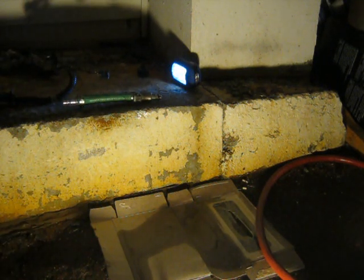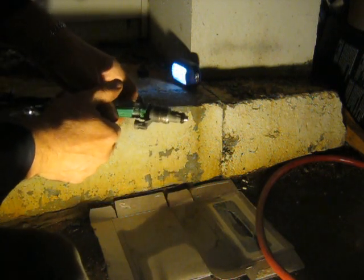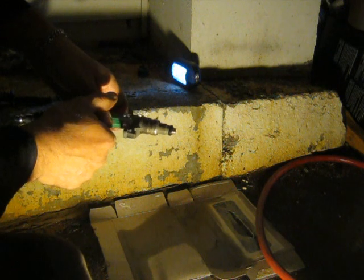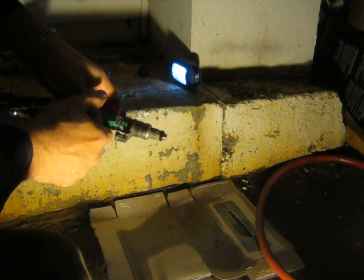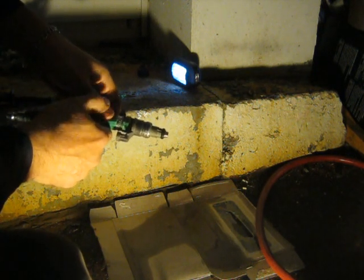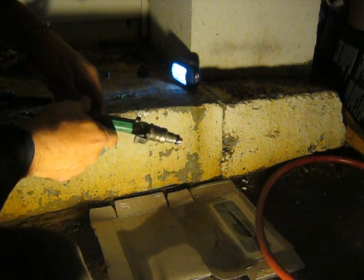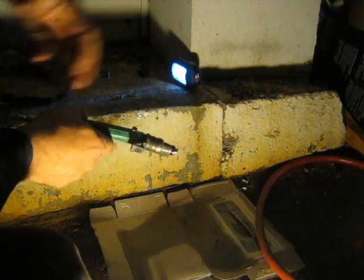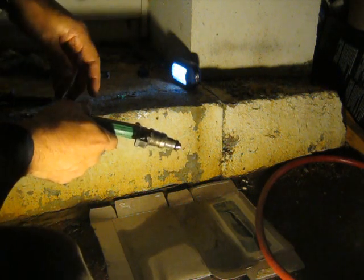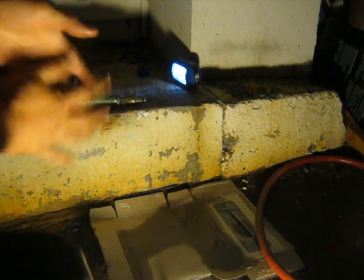A couple of precautions: you've got to do it outside in a well-ventilated area, no ignition sources — cigarettes, blowtorches, anything like that — because this stuff is flammable when it's spraying out of a nozzle like that. You just need a 6 to 12 volt electricity source. When spraying, you can pulse it, maybe if you had a second person. I don't pulse it because I'm within range of the spray mist and I don't want an explosion. So I just keep it going continuous, and it cleans the nozzles out just fine that way.